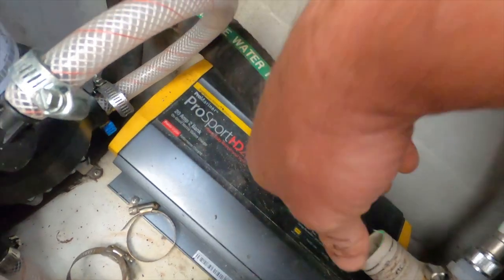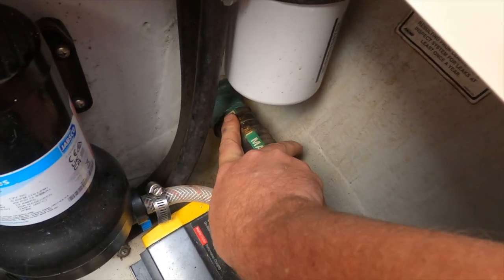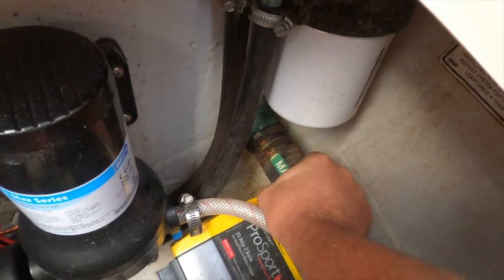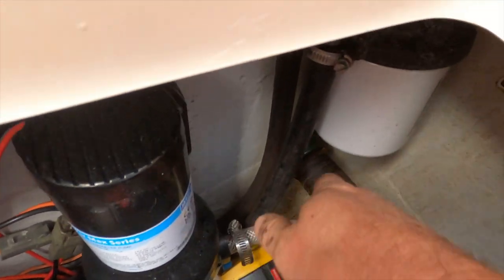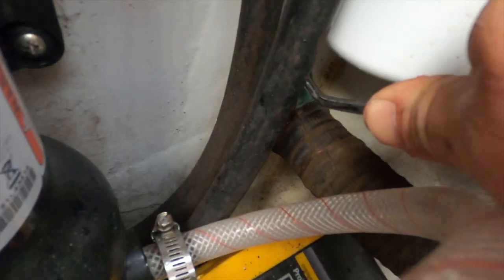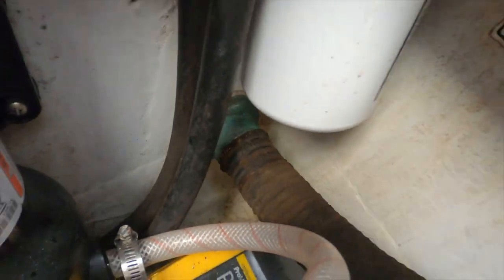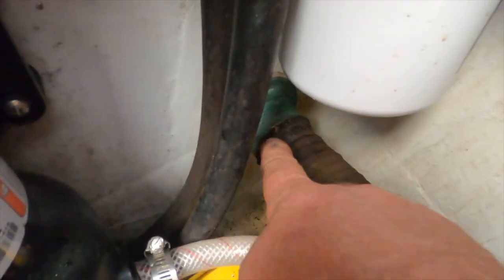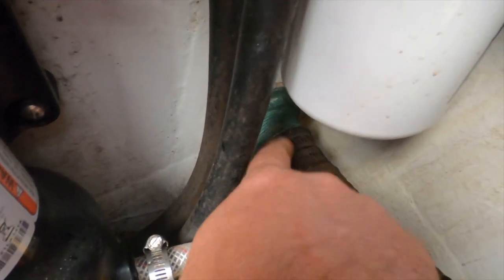The front side has a plastic fitting, but the rear fittings are stainless steel, and I'm anticipating that it's not going to come off nearly as easy. It's spinning but not moving at all like that front plastic fitting. I'm going to have to use the hose puller. With a normal rubber hose I'd cut it with a knife, but the problem is the steel reinforcement — you can cut past the rubber but you're not getting past the steel winding inside.